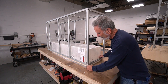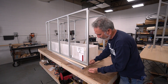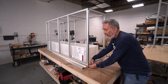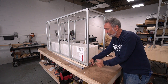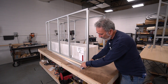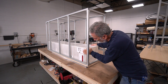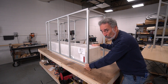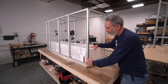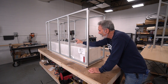I'll give you a full explanation when we're in the van, but while this is out on the table let me show you. The water tank sits on the van floor — I'll put in some heavy mass vinyl and a little foam insulation. That's the lowest we can get anything in the van. Then I come in with my one-inch tubing and half-inch plywood subfloor, then put the modules on top. That creates an inch-and-a-half trough that the water tank sits in, and the flooring built up around it holds the tank in place.